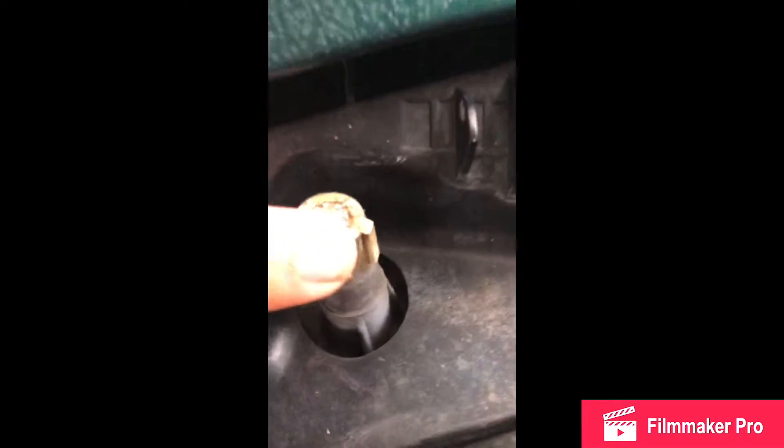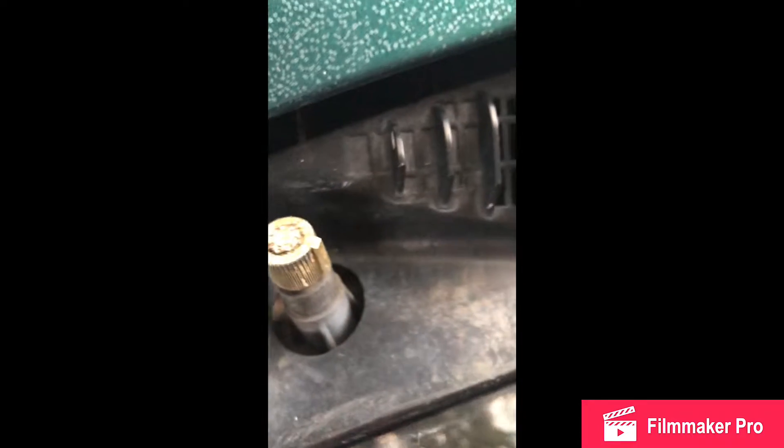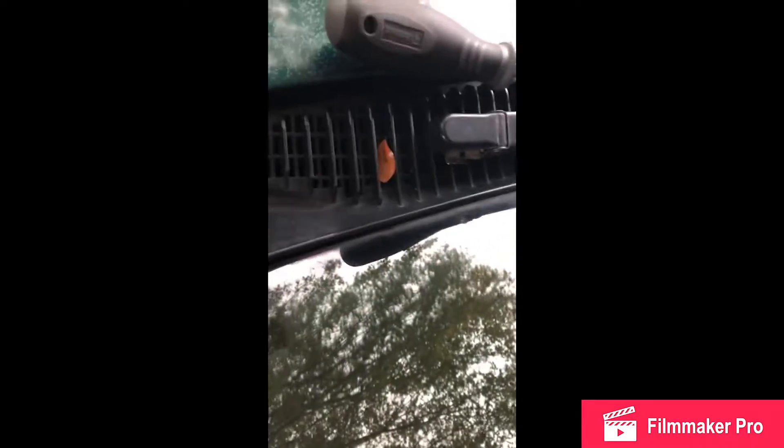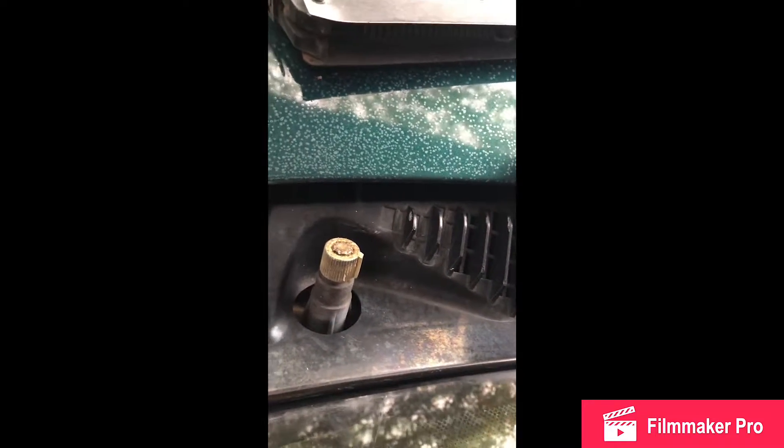What you don't want to do is hit your glass like that. I don't know why Chevy did it, but you can see right here it hits that spot. Fold it up and just don't hit your glass like I did. Now, normally if you're doing this on any other truck, it will not have this guide right here. As far as I know, OBS Chevys are the only ones that have it. But if you're doing this on a different truck, find where it fits flush against the glass, jimmy it up a little bit, and make a mark on both of them.